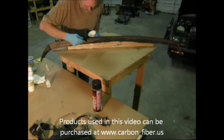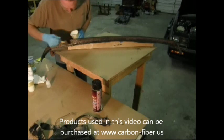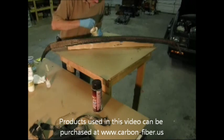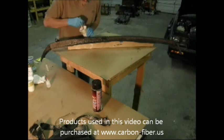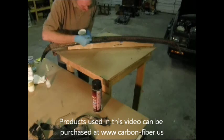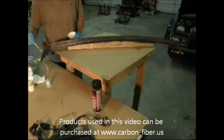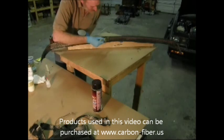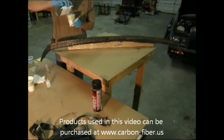At this point now, it's just a matter of going over the entire part with your brush. Just gently brush on the resin, and it helps to pump or stipple with the brush to force that resin through the two layers of carbon fiber and have them bond to that fiberglass spoiler. I'll actually do this probably three or four times, getting a good buildup.